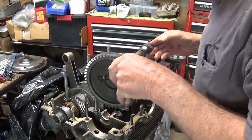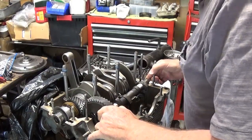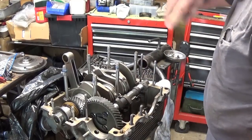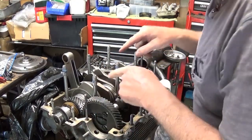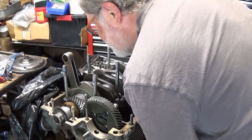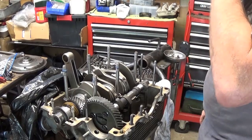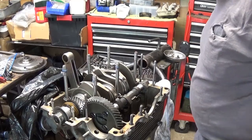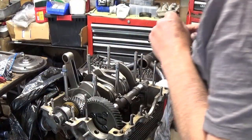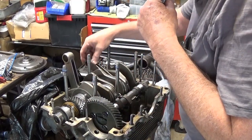Those are the old junk bearings, so I'm not too worried about it. But I've got the FK7 cam, and I've got rubber bands going through the head bolts on the other side to try to get my connecting rods a little closer to center. And so now, I just have my marker handy and start turning and see where it hits.